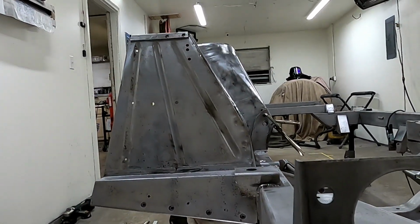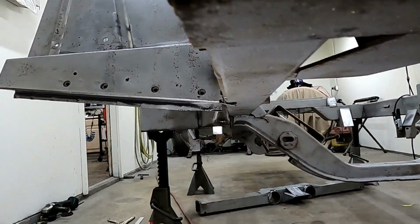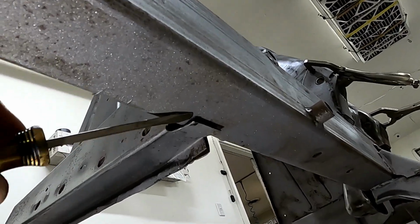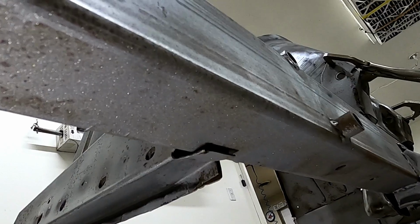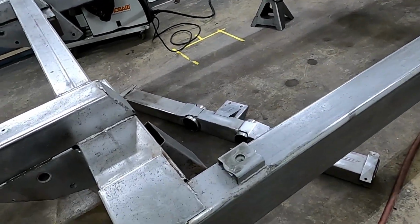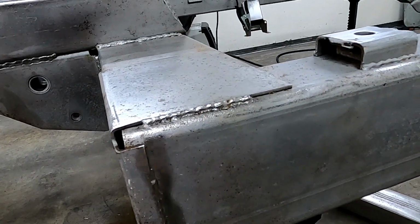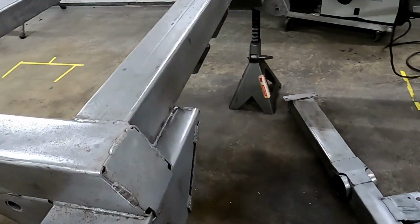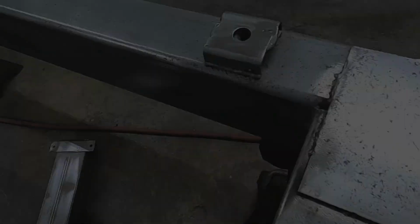One of the biggest problems with the spring tower connection is there's a missing weld on mid to late '75s right here on this tab. Putting a screwdriver in it demonstrates there's nothing there. You may find a few skimpy welds, such as this one right here, that may need to be re-welded. And some of the welds could have been taken a little bit farther, such as these right here.